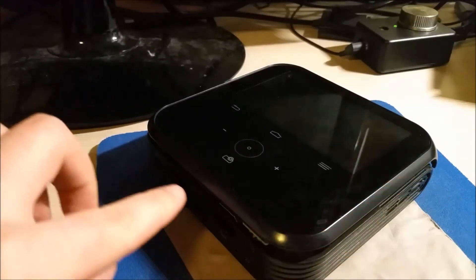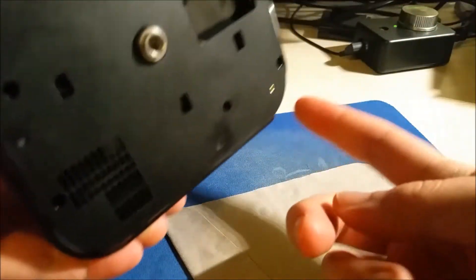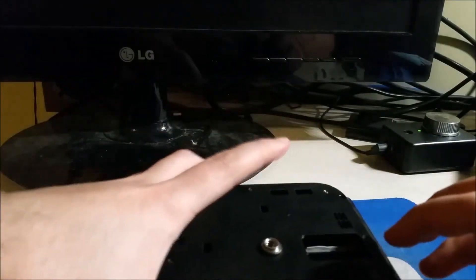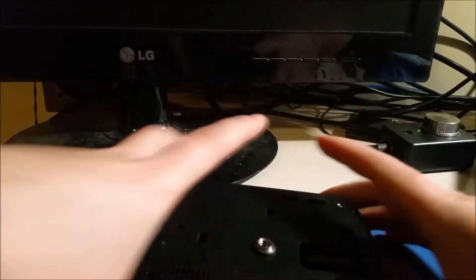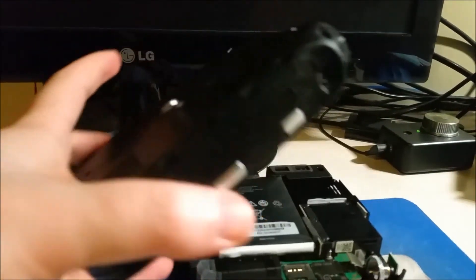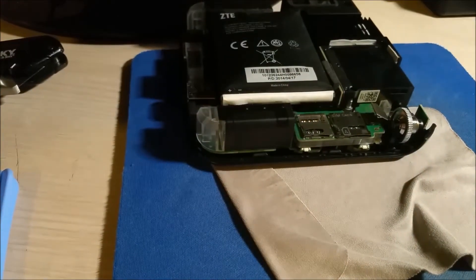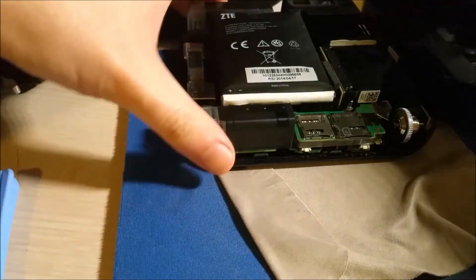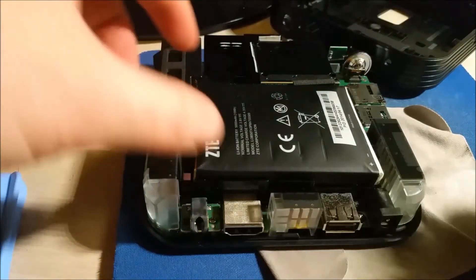I took the pocket knife and pried a little bit around the top and the two front corners. I can feel the bottom is now loose. The only thing that seems to catch is down here — there's a wheel for the focus mechanism, so you want to make sure you lever it kind of this way and then pull outwards so that it doesn't catch on the plastic. And holy — swollen battery. This guy is coming out right now. Oh my goodness, that is absolutely horrible.